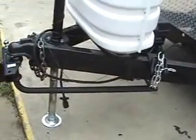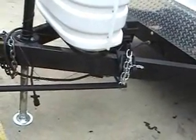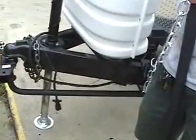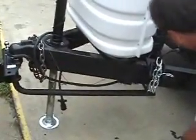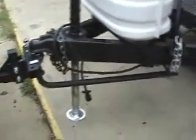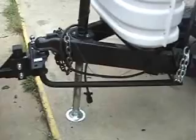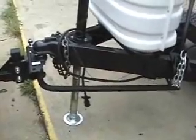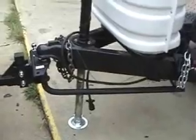The rule of thumb is, if you pick that up it makes the bars hook up easier. Before I take that bar off, the first thing I'm going to do is jack the trailer back up in the air with the truck. Make sure there's not a lot of tension on it. Then you're going to come right here and put the bar here, undo it, and then roll that over, roll it down. If you've got a lot of tension on it, it's going to hit you. So jack it up and get the tension off — another good reason to have that electronic jack.